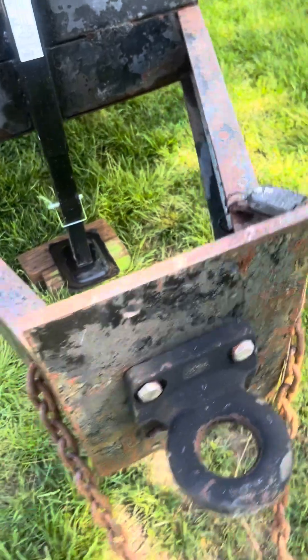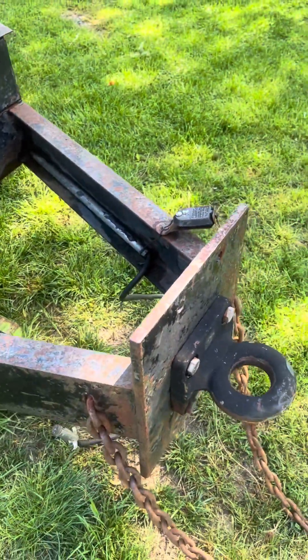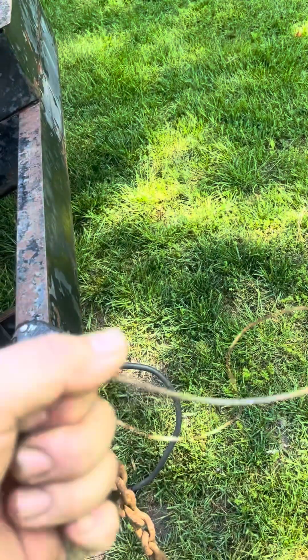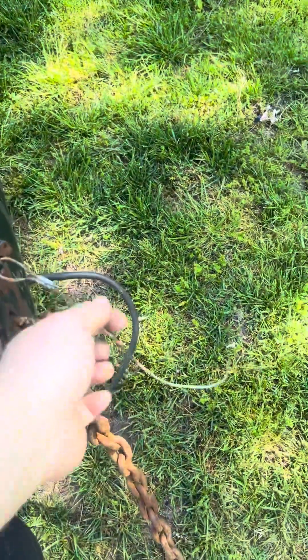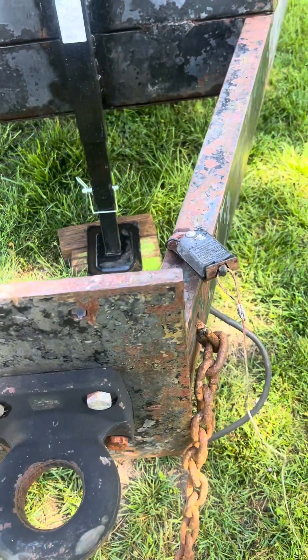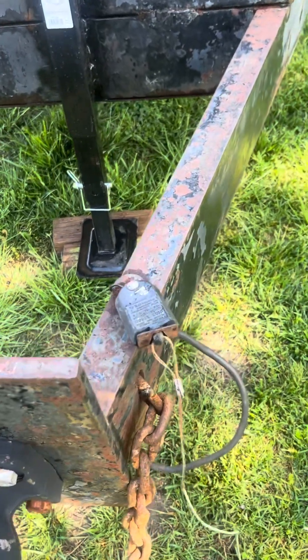That's why I decided to make this video — you've got to mount this ideally independent of your hitch and someplace solid. This will pull out; it's a steel cable, it's either gonna break that pin or pull out. But if it's mounted to something cheesy, it's just gonna rip right through it. So stay safe, see you guys on the next one.